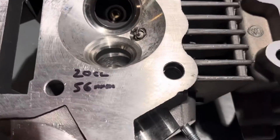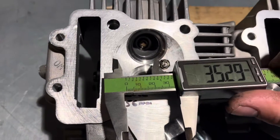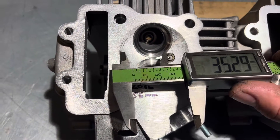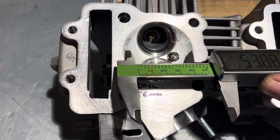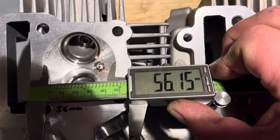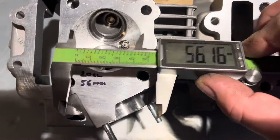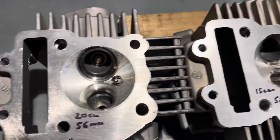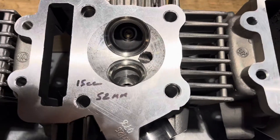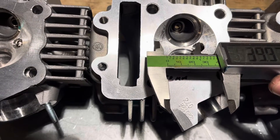The stock 160 has a 56mm diameter across the combustion chamber. We're up to 56mm across the outside of the Hemi and that's a 20cc combustion chamber. The red tag is a 15cc, 52mm — that's where we gain the compression.